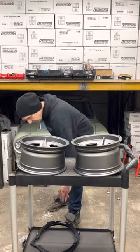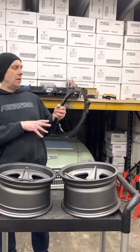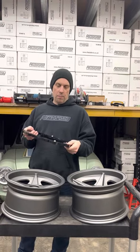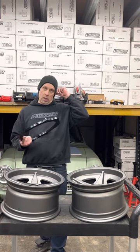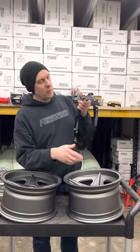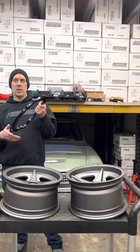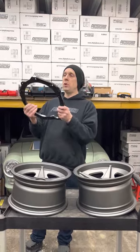One other product that has been out of stock forever is the Mazda MX-5 to Ford adapter plates. These are normally made out of 15mm aluminium — typically we were having these water jet cut and then machined with a fixture. But the price of aluminium has gone through the roof a little bit and we've struggled with the quality from a couple of manufacturers. So we've now decided these are made completely out of billet — not water jet, complete billet — and we've added hard black anodising and put a logo on it. Quite a few people have been waiting for these to come back into stock so they can get their Mazda gearbox up to the back of their Ford. They're back in stock, they're on the website, you can order those and they'll come to you next day.